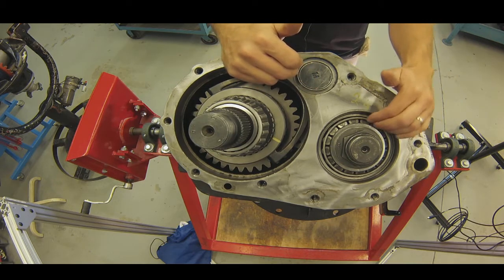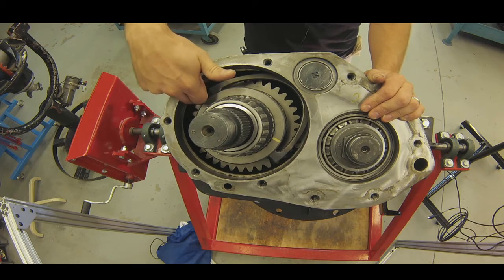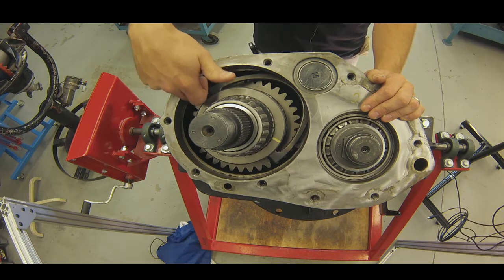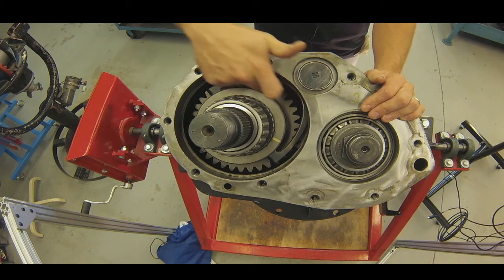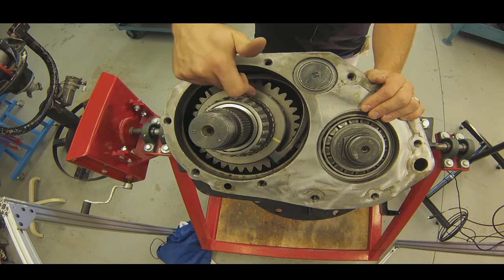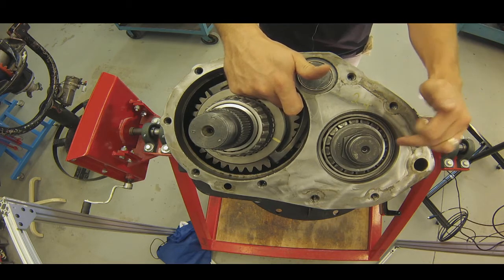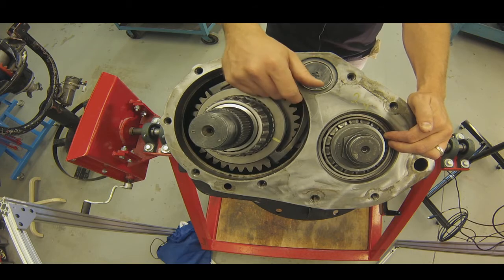The input comes down into the cross shaft, the cross shaft drives the differential pinion gears, and those pinion gears drive the side gear profile of this helical gear right here. We know it's this one because that's what the lock collar locks to — it locks the input shaft to that helical gear. This helical drive gear is what drives the pinion through that helical driven gear, as the book explains.